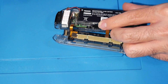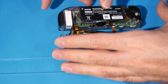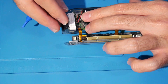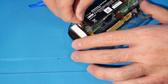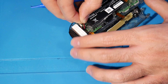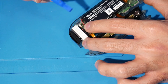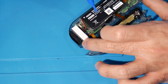Pop the antenna connector into place — you're doing a few things at once here. Make sure you have proper connectivity and don't pinch or damage anything. For connecting the battery, look at the connector — there are two notches on the bottom that face toward the motherboard. Line it up just above the battery connector, making sure it's touching, then take your spudger and apply a little pressure from above and it connects beautifully.